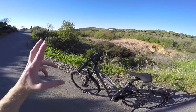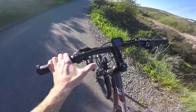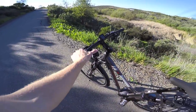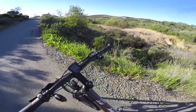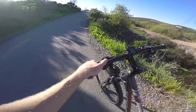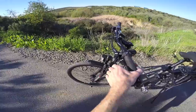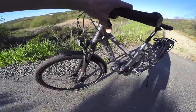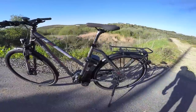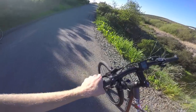Another safety feature: these cool bells with a funky design — you can reach it really easily along with the trigger shifters, nine-speed, and the different dials for your display panel. We've got nice hydraulic Shimano disc brakes with a 180 millimeter disc in the front and a 160 millimeter disc in the rear. They're going to be a little bit easier to pull with maybe just a finger or two, giving you lots of stopping power.